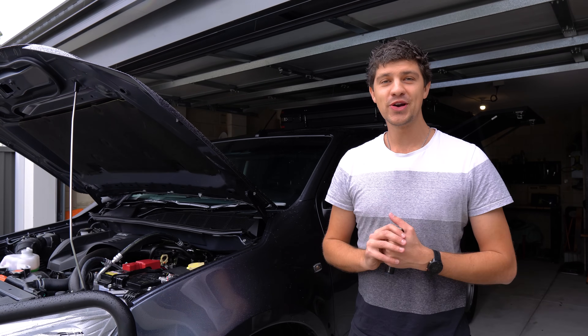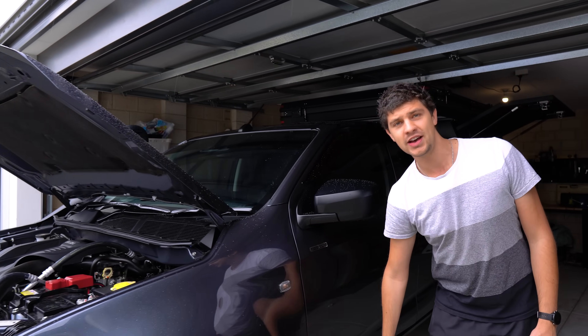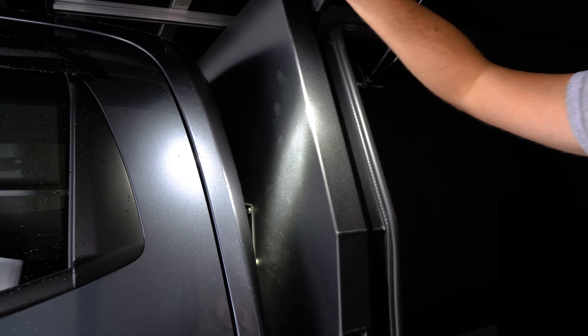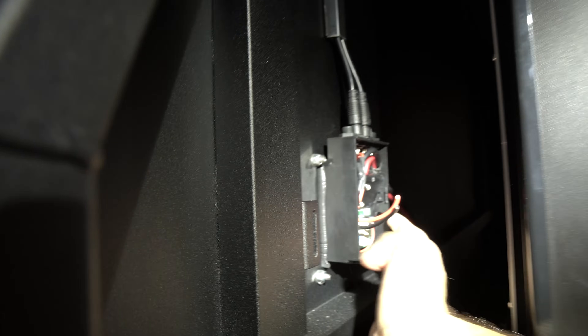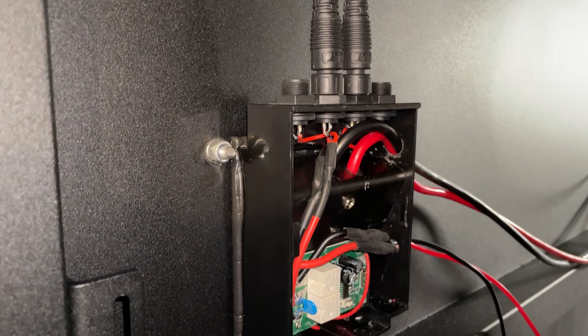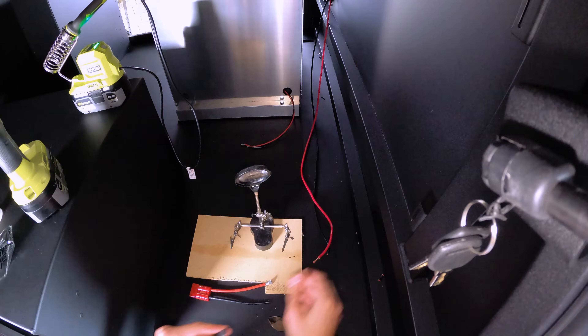It's a brand new day and we're back in the garage. We've now got the 100 amp cable running all the way from the main battery back to the canopy, through a fuse and under the body of the car. I've taken my time to cable-tie all that wiring nice and high, out of the way of sticks or rocks while four-wheel driving. It enters the canopy through a brand new Anderson connection into that flush mount Anderson inlet. My big thick power cable now shoots off to where the DC-DC charger will eventually be, then to the battery, the fuse box, and back to the central locking system.